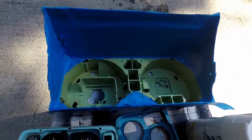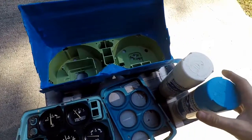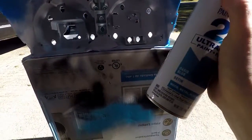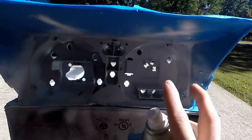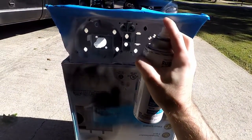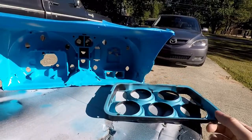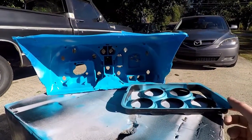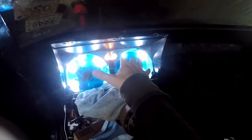Before, with white LEDs, they were showing green on the inside, which is not what I was going for. So we'll hit it with white to neutralize it as a base color, and we'll go over with this blue color and it should be a close enough match. The gloss white is on there, we're about to hit it with this blue. Here's a little test spray of it — not quite the same blue but I think it's close enough that it's going to do the job. We've got a nice flat neutral white, put this right over it. And here are the results: this is the instrument cluster gauge and this blue is a pretty close match. It's not perfect, but it is pretty darn close, and I think it's going to do exactly what we need it to do. Got the lights all working, even the one I repaired — we're good to go. Let's put the cover on, let's see if the colors match.